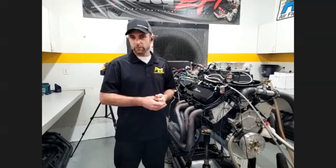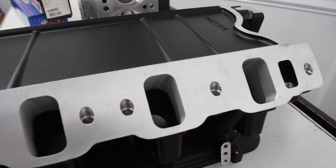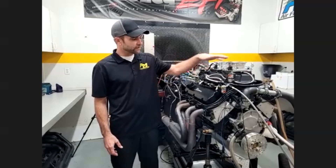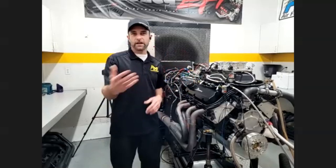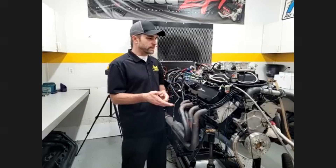We showed you a bit of the port matching. They leave it small, which is nice, so we can match it up with any cylinder head we choose to use. But more so, the reason I chose it was for the line of sight to the valve and a bigger plenum area. Enhancing the base combination was really about the base power — trying to get it up past that 600 level for a solid naturally aspirated power level before we smack it with the nitrous. That's where the guys at Holley come in, and obviously that's where we are now with the engine sitting on the dyno.